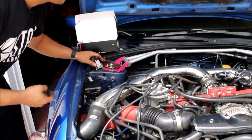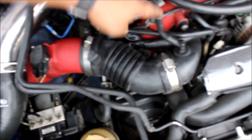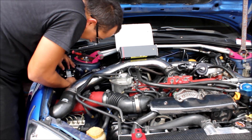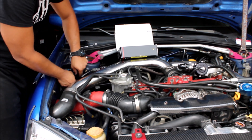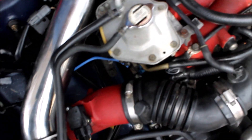Let's run the wires and see how it goes. First one is intake to port one right here — port one goes to the turbo inlet right here, I ran it down right here. Port three goes to the turbo, so we have to run the line here to right there — that's the middle one, port three.